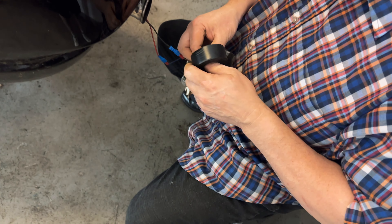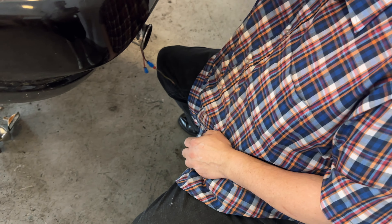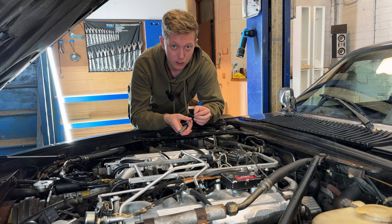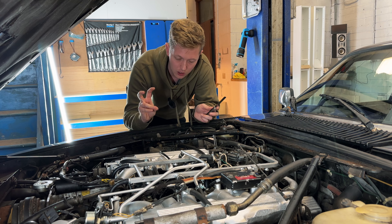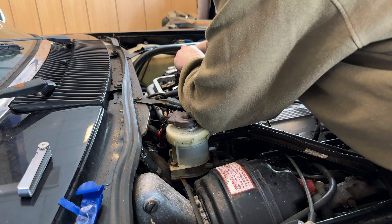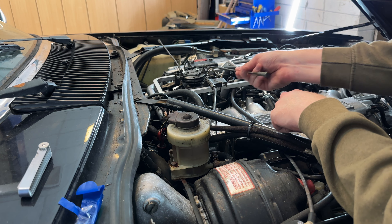Jack, I'm just stood here watching you — maybe I should actually help you. The throttle body should be open 0.002 inches when it's closed. First thing I'm going to do is take off these pieces here and pop off this side too. There we go — those throttle pedestal pieces are off. That's what moves the throttle bodies.